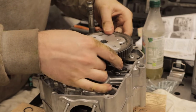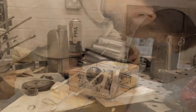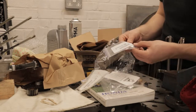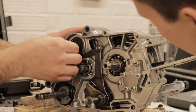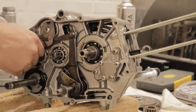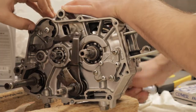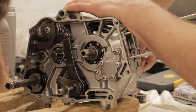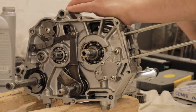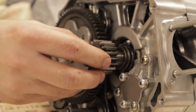At this point we were making really good progress so we started to move towards the drive side of the engine. I actually found at this point that we had an issue with the engine. I put this final timing gear on and then worked out that the engine was not shifting - you're getting two of the gears but the third one wasn't selectable. It came down to a tiny pin on the selector shaft, so we got an order from CMSL and it started working as it should. It was a bit of a setback but it really emphasizes the importance of checking your engine and making sure the gearbox works before you continue on, because imagine getting it back in the bike and then going to shift and missing that. You can see here we spin the engine over, click through the gears, you can see the selector shaft working and spinning that barrel.